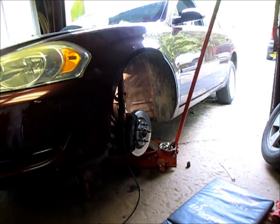We're back in the shop with our '07 Chevy Impala jacked up, wheel off, and bolts hosed down with some penetrating oil. Today's project is to replace the CV axle — one of the boots has a slight rip in it and it's starting to fling grease all over the place, so it will fail soon enough without any grease left in it.